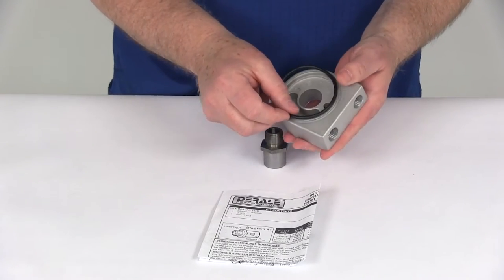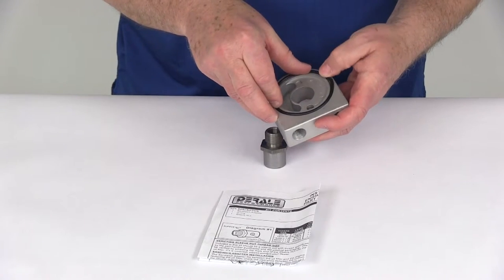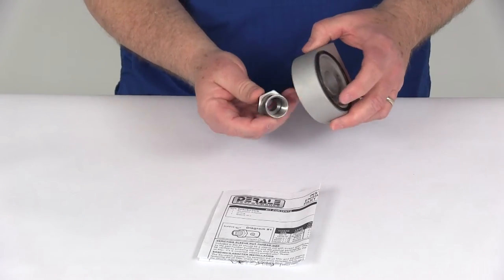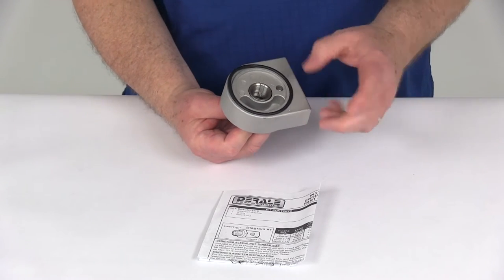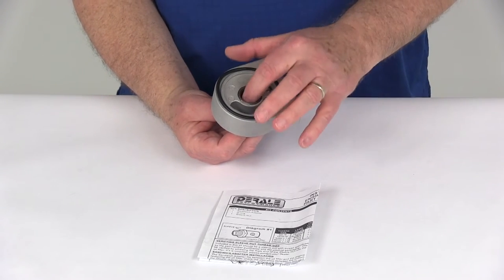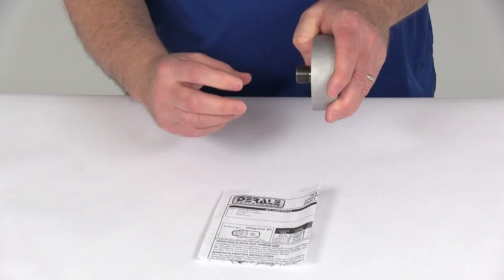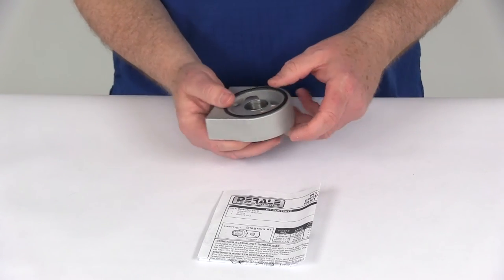When you go to install this, put some oil on your o-ring before you put it in. The o-ring will go up against your engine block. The sleeve nut will go up through the adapter and thread onto where your oil filter was — when you take your factory oil filter off your engine, it'll have the threads there. That'll thread on, and then the o-ring will seal it. You'll have the threads sticking through, so your oil filter will tighten up right against here, and these are your oil lines that will go through there. Very simple operation.